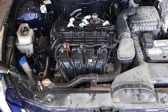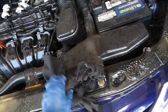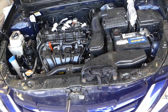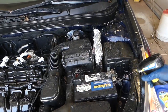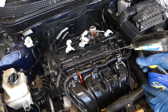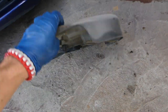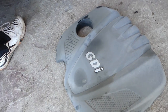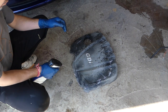Here at the intake, I'm going to cover it so we don't get water inside — you want to cover your intake where the car sucks air from so you don't cause any damage. We'll spray a little more on top of the air filter box. You can see it's eating the grime now — we can hit those spots a few more times. For the foam piece on the back side of the valve cover, you can remove it and dry it if it gets wet, then put it back, because otherwise it can wet the connectors underneath.